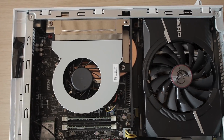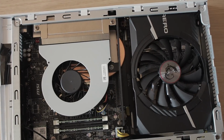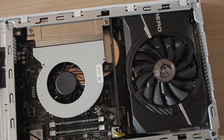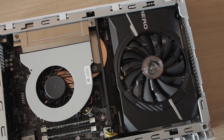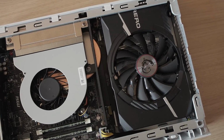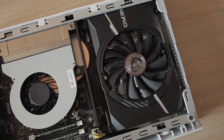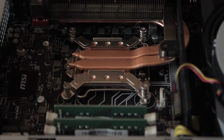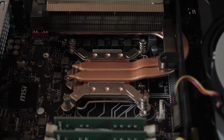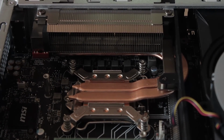Well, the GPU wasn't too bad, as it has a really good cooler for a video card on it with the MSI Torx fan, and went up to 75 degrees Celsius. The fan works only when going over 50 degrees Celsius, so when surfing the web it just doesn't spin at all. Now, the CPU. Dear Lord, what the actual hell! It was a steady 100 degrees!